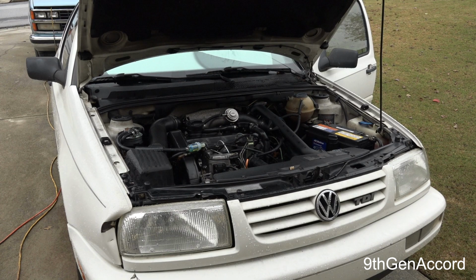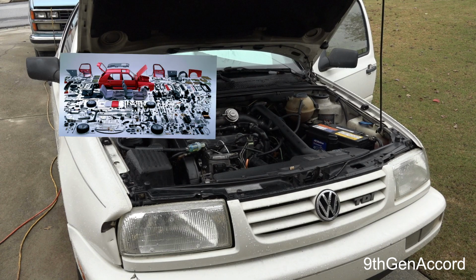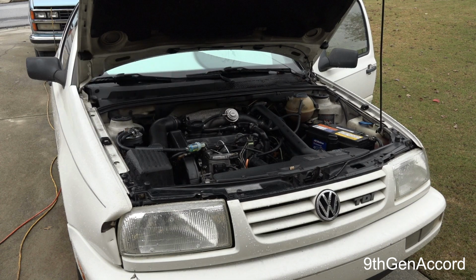I checked the glow plugs, the injectors, the glow plug circuit. I replaced the relay 109. I cut the catalytic converter off. Thankfully, I did do that because it was about 80% clogged, but none of these things that I did made the car start. Then it got to a point where the car just would not start anymore at all.